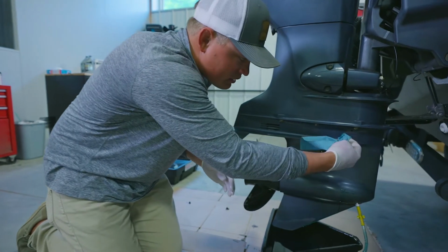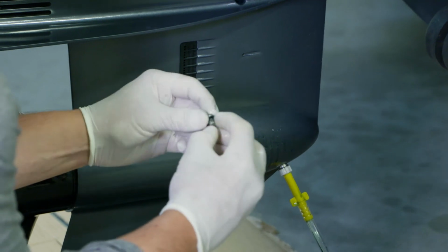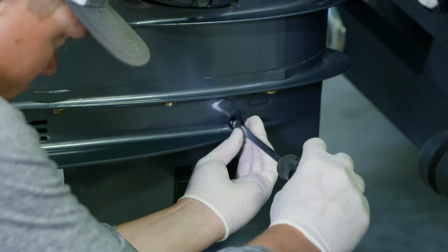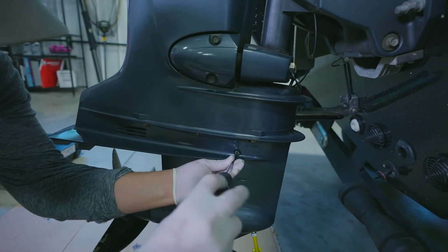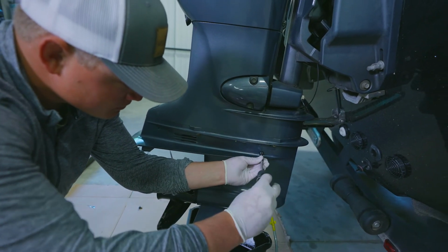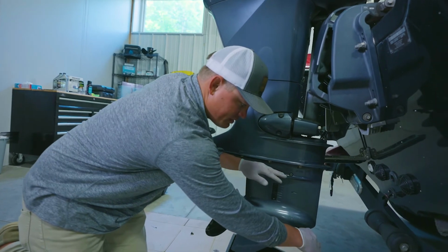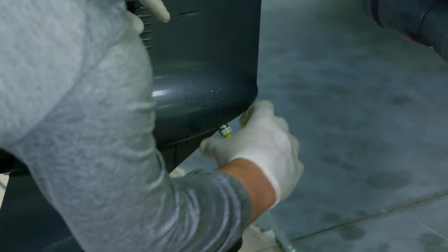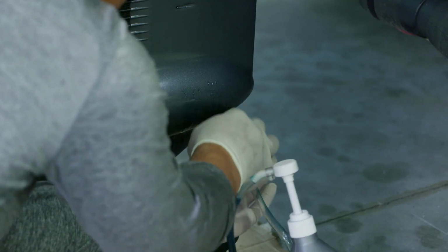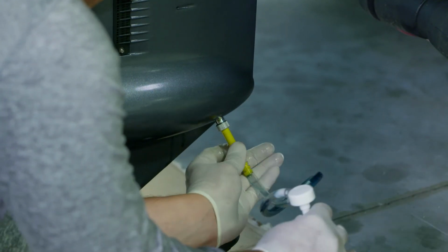grab a paper towel, clean this up a little bit, and then take a little bit of the new oil, put it on the threads and the gasket of this top leveling screw. And then it's important to replace this before unscrewing the pump. So that's in there. Don't over tighten it. Now, because I have this replaced, I can unscrew this. And there shouldn't be too much drippage coming out of the bottom here, because I have this top screw replaced. So there's minimal airflow through there.